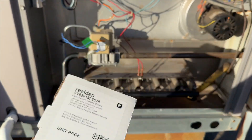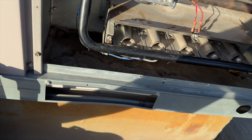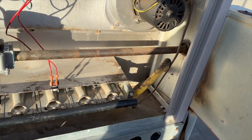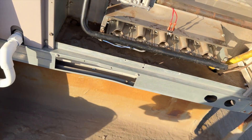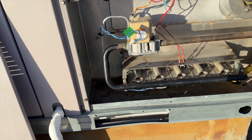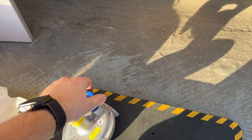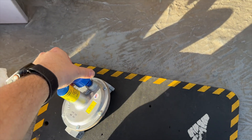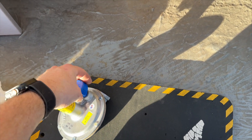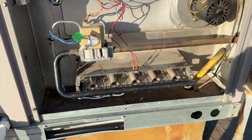We're back on this one. Got the smart valve and also got one of these — that's the igniter assembly. So we're going to go ahead and put a new regulator even though the old one's fine, but it's got this limiter on it, which is pretty much for indoor use only. If you're going outdoor, you want to have this big blue vent protector. You just unscrew the brass limiter piece and screw this on. Nobody carries them in stock so we have to stock them, but they're really easy to do. We're worried there might already be water in the old one, so we don't want to risk going down again. So we're replacing the regulator, the gas valve, and the igniter assembly.